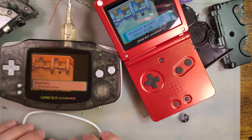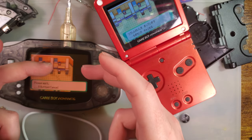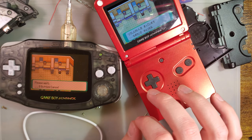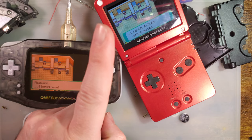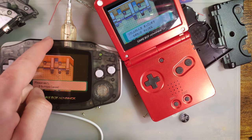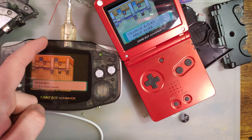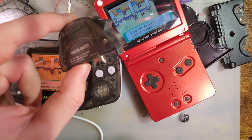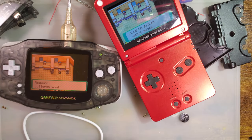Here's the workaround. There is actually a second version of this kit. The PCB adapter and screen and everything about it is identical, except for the cable and how you're supposed to wire it up. Instead of wiring up this kit to pin 3 — which is what I did in the last video — you're supposed to wire up the new one with a different cable to pin 1 of the link port, and you're supposed to remove some additional components on the Game Boy Advance. Pin 1 is the power line of the link port.